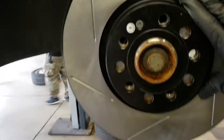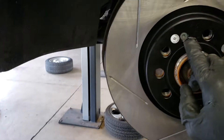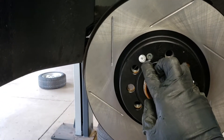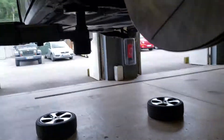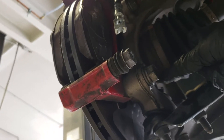If I sound a little tired, it's because I went out to a club last night and was doing a little drinking — a tad bit dehydrated, a little hungover — but we're going to get through it. We got the rotors installed and everything fits up perfectly. We put the Torx 30 bolt back in. A key note on installing these rotors: they are directional and have a sticker saying right and left, so make sure you put them on the correct side. The caliper mounting bolts are back installed — those big 21mm bolts need to be torqued to 200 Newton-meters, which is a pretty high torque spec.